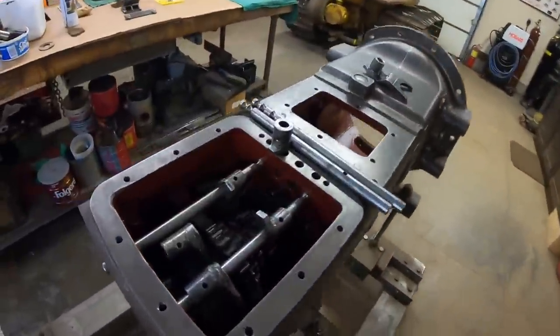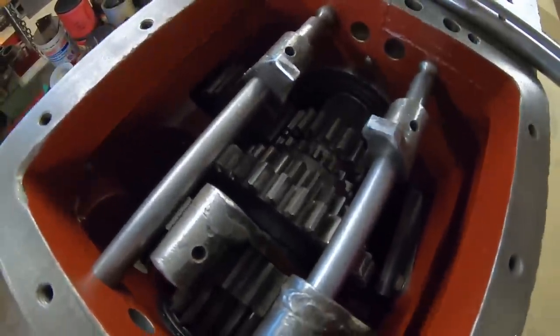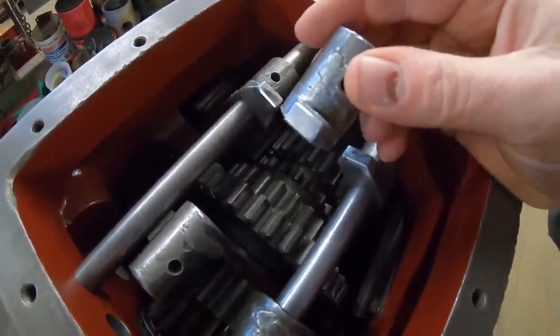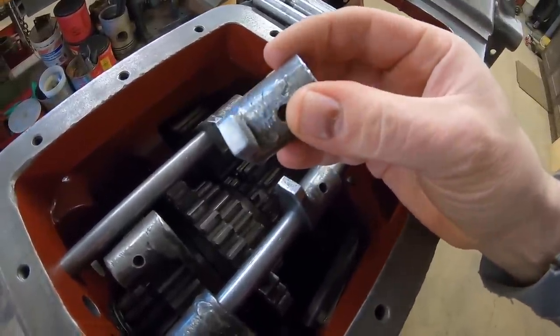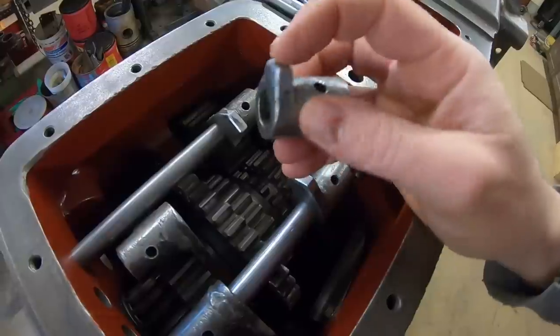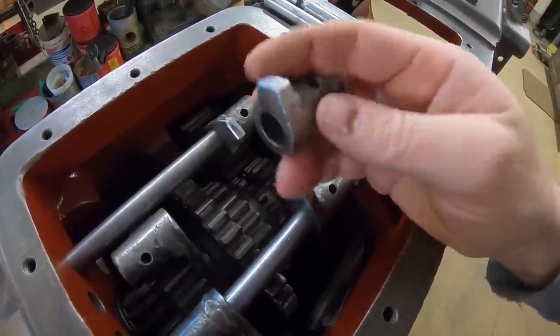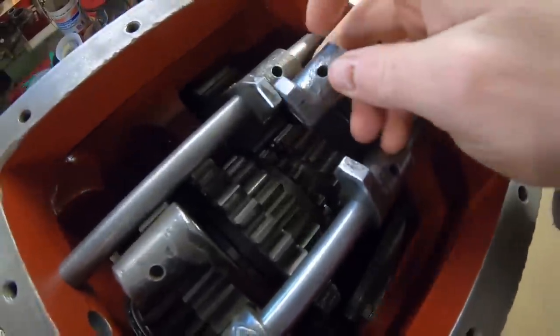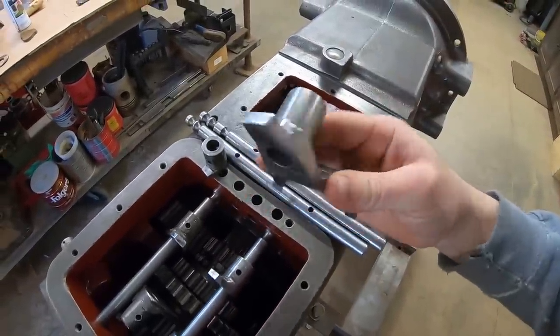I spent part of this morning building up these worn portions of the existing forks and dogs. You can see this one was the one that went right there on the number four rail, and it was really worn down. So I added some metal and filed it back down, just kind of like a zap, zap, file, file, zap, file, until they were all reshaped and looking more like the top of our new fork.